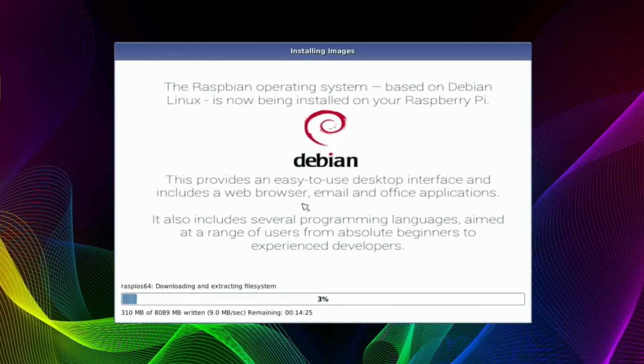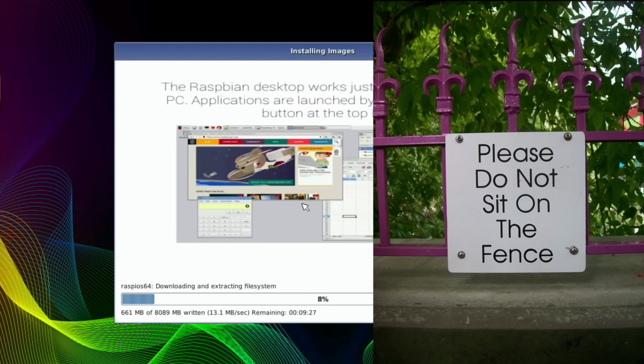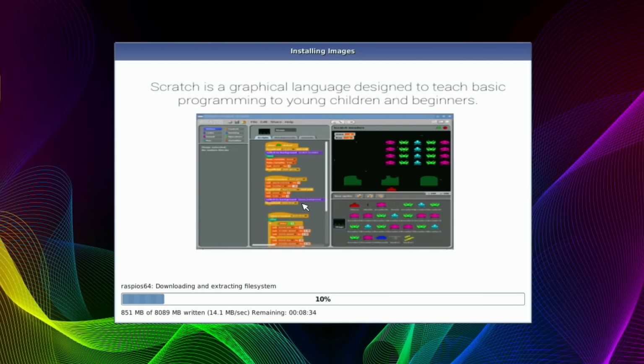Berryboot supports more systems, but I think I'm right in saying, I haven't looked at this for a while, it still needs an SD card to boot from. Just the initial boot, so it doesn't run the operating system from it, whereas Pinn OS, the whole lot is running from the M.2 drive. But I often get asked which one is better between the two. They're just different and they're both great. So Berryboot has got more systems, Pinn OS can run off one drive, and yeah, I like them equally. But if you want to know more about Berryboot, more about Pinn OS, then have a look at my channel. I've done loads of videos on both of them.